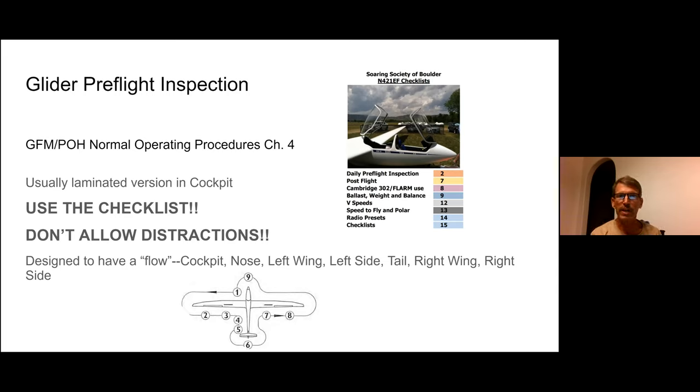Landing gear failures. I can talk a little bit about this one. I had my first gear up landing in any aircraft at all when I was at Salida. It was unanticipated, and it was a gear handle coming out of the detent failure. So the gear was down and then went up, but I've experienced it. I can say that it makes a horrendous noise, but think first and foremost about keeping the wing tips up and doing the best you can to control your direction down the runway if you have it, and don't worry too much about the aircraft. That's my personal advice on that.